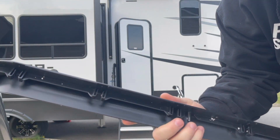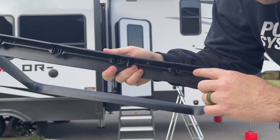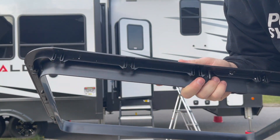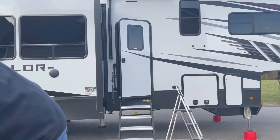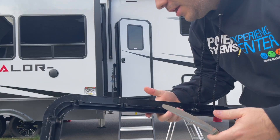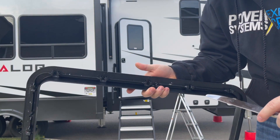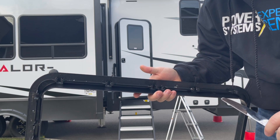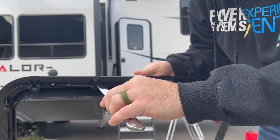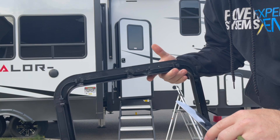The problem with this Lippert window is that there are no screws to speak of. I was expecting a really simple install, but it's got these kind of funny clips in them. I watched a couple of videos and people all seem to have the kits — they were actually still breaking the tabs either on this side or on the other side of the window even with the kit. What I found was that a butter knife is actually about the ideal size to get in here, thanks to a post that I'll link below.